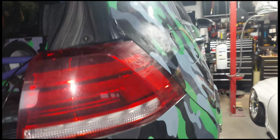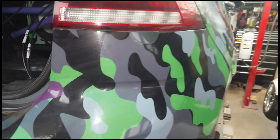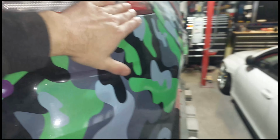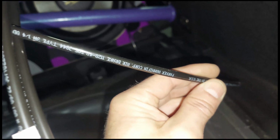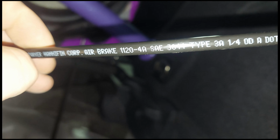Now, a lot of people are like, well, you're running lines on the exterior, you're exposed to a lot more elements. I mean, the lines we use, and the lines that you guys should be using, are DOT rated. There's no real certification or approval, but they're manufactured to the DOT specifications. And you can see that because on all the air lines, it will tell you SAE type 3A, and somewhere here there should be Parker-Hannifin air brake line SAE extruded in the USA. Somewhere on the line it will say that it's got a DOT rating. There you go, DOT